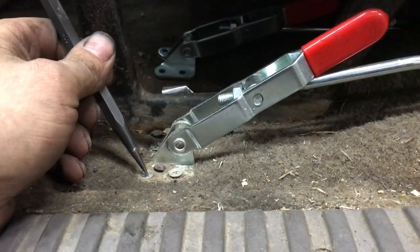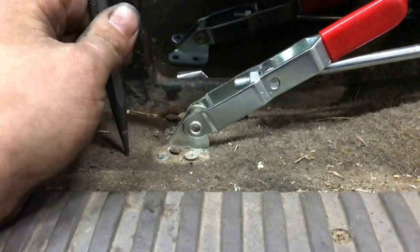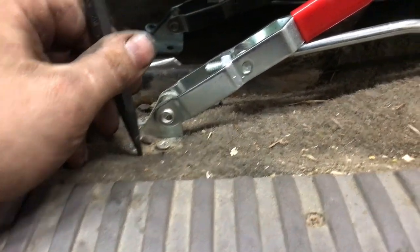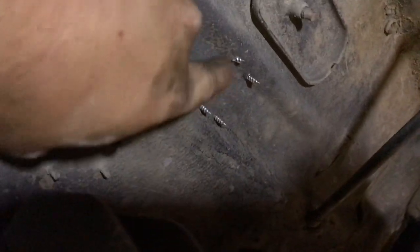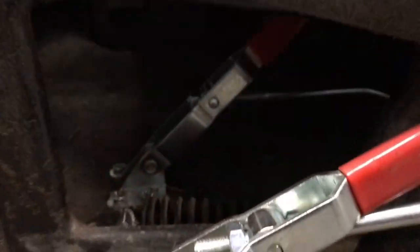Lock it with a hammer and you'll drive that sucker right through the sheet metal. By doing that, because you're not drilling the material out - you're not using a self-tapper that's drilling the material out, you're not fighting the insulation and the carpet getting all bunged up on your drill bit. That will take the material that's there and displace it. Right here is where the cable comes through - you can see that lip. That's the material we displaced by using the punch. That gives your screws something to really bite into versus just being 18 gauge sheet metal floor where you overtighten the screw and she strips out.